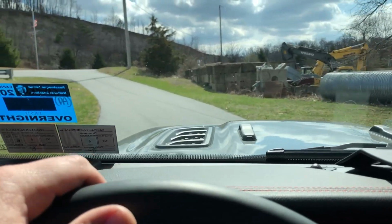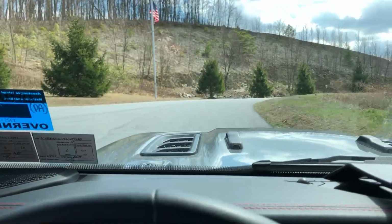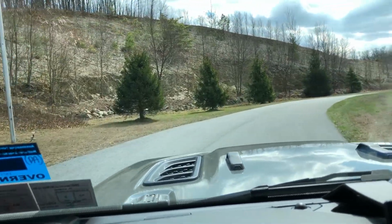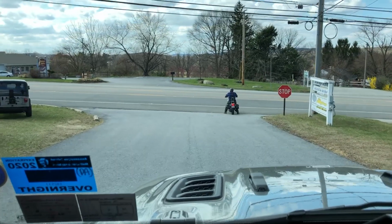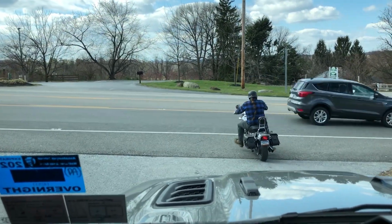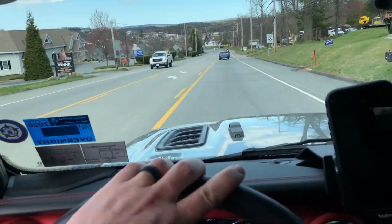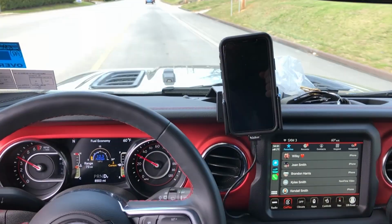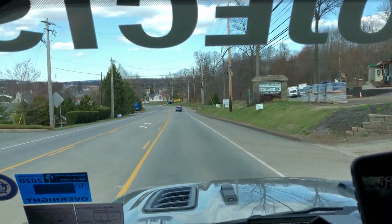You may notice the improvement when you go on a road test, but when you get out on the highway, your steering might be off a little bit. So what we're doing right now, Tracy's with me, is some adjusting and testing, adjusting and testing, until we get it perfect again. And I'll show you why. Right there is why. The steering wheel is a little bit to your left when you're going straight.